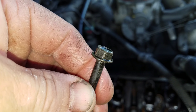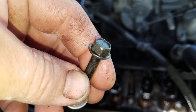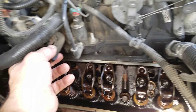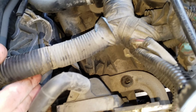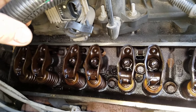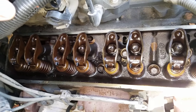Don't be surprised — these bolts get stuck on your socket. I don't know why they do, they always do. It may be just a little bit between sizes; it may be standard. Take the bolts out, remove the valve cover. There's a little bracket here with two nuts — take those out, it loosens the bracket. Release this clamp and there's another clamp over there, so you can move this harness around to get that valve cover out. It's pretty tight and it'll be worse going back in trying to keep that gasket on.